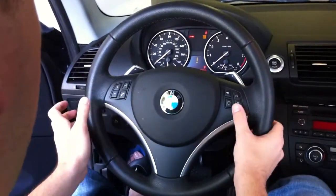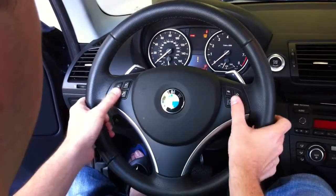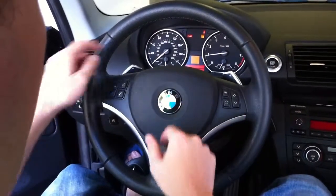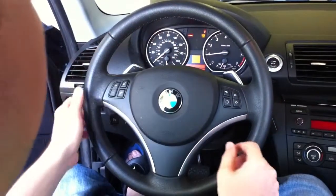To get into the system, you're going to press down both the channel and the volume buttons at the same time. You'll see the orange screen comes on, indicating you're in command mode.